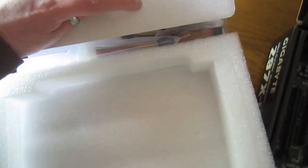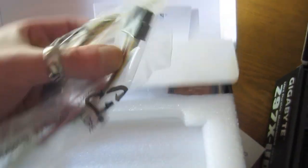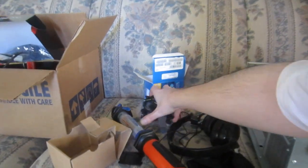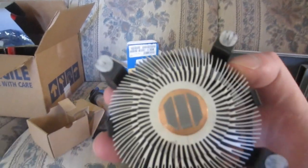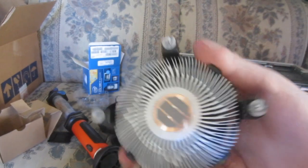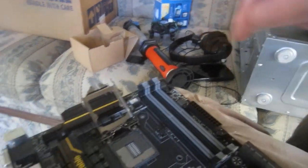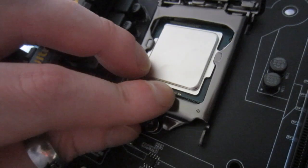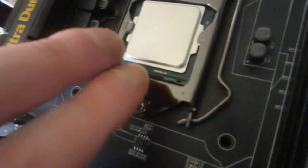Not much included — just a couple of adapters and an SLI bridge. I got the i7 here, so that's a very pricey CPU, so I'm going to take a lot of caution. Installing it is pretty easy — just match the little arrow on here to the arrow on the socket. I'm going to use stock cooling, and this one is actually pre-applied with thermal paste, so I don't need to apply any, although I do have some. On the back there are two little notches where the CPU goes in, so it's really hard to mess up — it's a no-brainer. Just pop it down, put it back where it came from, make sure you're not using too much force, and snap it into place. Your CPU is installed.